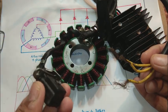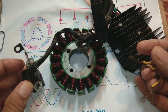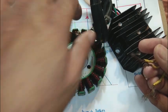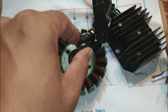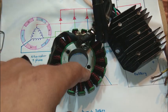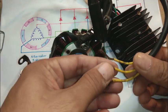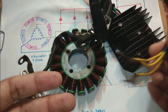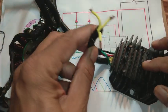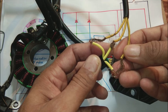This coil is located outside the magnet. A permanent magnet — with north and south poles — is turning all the time with the engine. The crankshaft comes out and a magnet is fixed on it, turning on these poles. These permanent magnets induce voltages in these 18 poles, and that voltage or power comes out through this cable. This regulator part accepts these three wires which are connected to it.